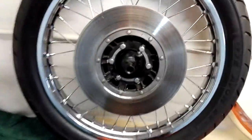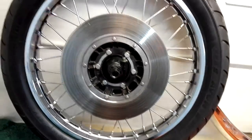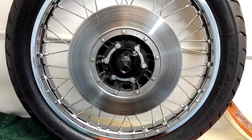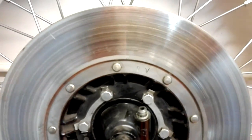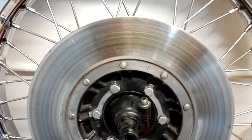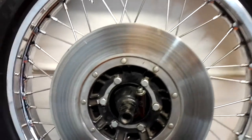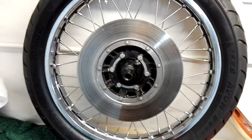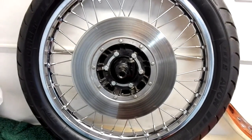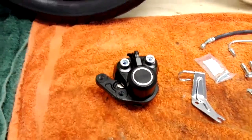The bit I'm missing is a brake disc, because as I speak now they are not available. Apparently someone is going to make some, but they won't be made for about another 6 months, so I've had to find a second-hand disc. There's a date mark there — 8V. I'm not quite sure what it stands for, but if you're finding another disc and want to be totally perfect, try to find a disc with a similar stamping to the one you've already got. Ironically, the discs are apparently available for the Z900, but of course what isn't available for the Z900 is the brake caliper.